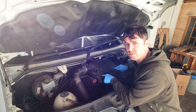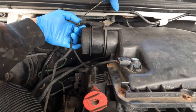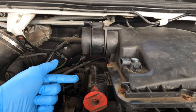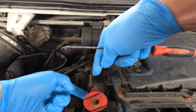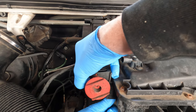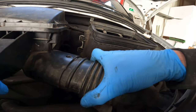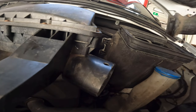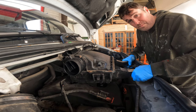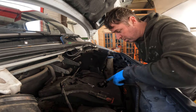First you need to remove this air filter housing. You remove the electrical clips here and here. This cable is for jump-starting - the positive lead for your battery. There is a piece of plastic under here that you push in and that slides up. It's the same process here for the oil filler neck. Now we can remove the air filter housing - it just pops up here at the front of the engine bay and it slides off. There is a screw here.